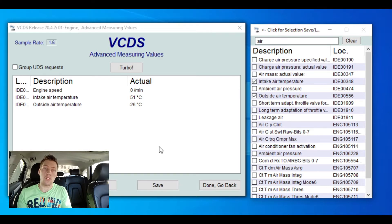We're going to go to the road and do a third gear pull. I know a fourth gear pull is recommended, but on a safer road, fourth gear would reach a crazy amount of speed. I'd suggest doing a fourth gear pull on a dyno. In third gear I'll reach about 120 km/h, which is highway speed. We'll take the car into third gear, keep the RPMs low, click start on the laptop, then put our foot flat to the floor all the way until the car shifts. For a manual, take it to the red line. Then let go of the throttle, slow down when it's safe, press stop, and drive back home.